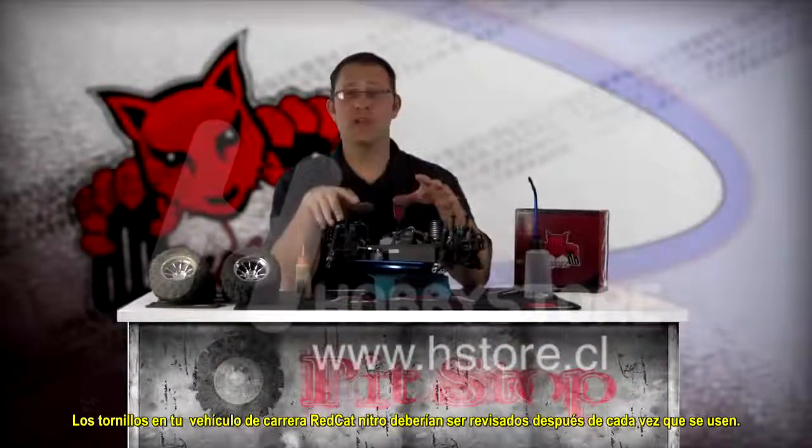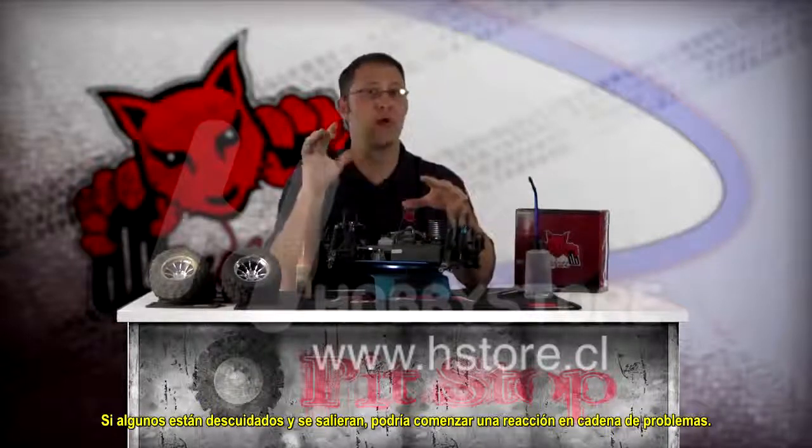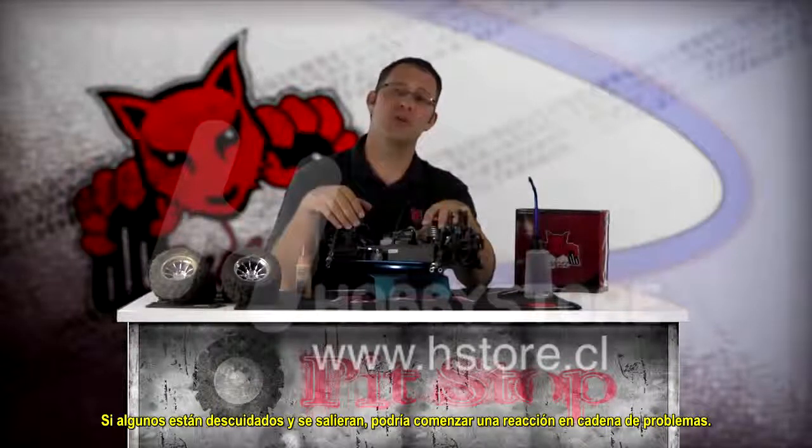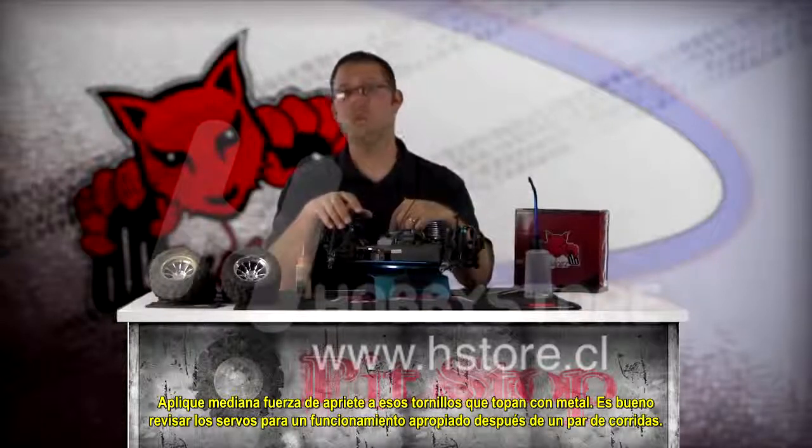Screws on your RedCat Racing Nitro vehicle should be checked after each run. If any are neglected and work their way out, it could start a chain reaction of problems. Apply blue medium strength thread lock to those screws nested into metal.